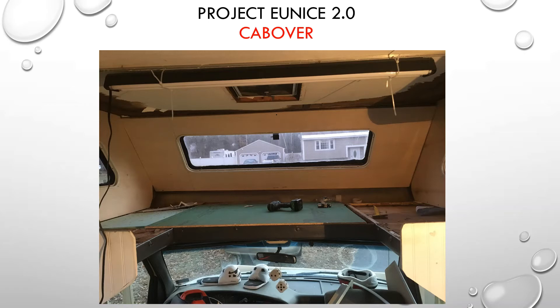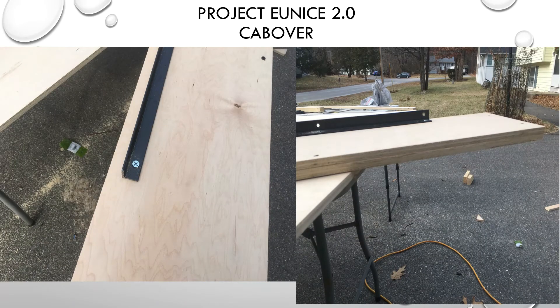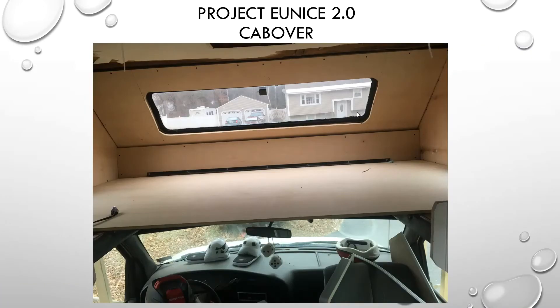I put in one piece — eventually screwed on the perimeter. I used construction adhesive and pressed everything together so it made one solid wall. The other side got put in and things were getting more solid. One of the previous slides, I mentioned that horizontal piece of wood that went across the span and the width of the camper and gave it support. This was the replacement for it: two pieces of half-inch poplar plywood butted up and screwed to each other, with a piece of angle iron in there. This acted like a bridge, giving it horizontal support across the span — very, very, very important.